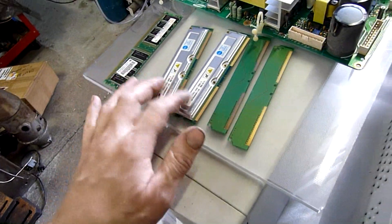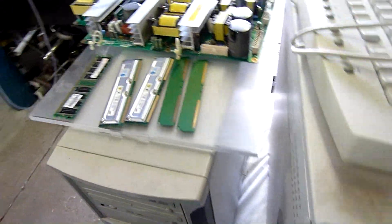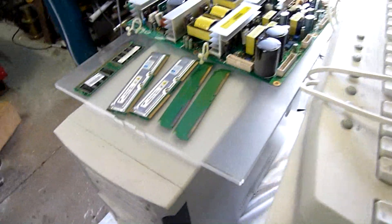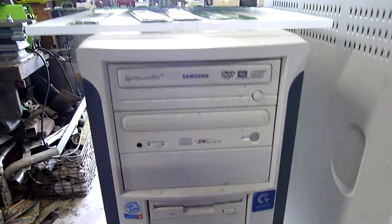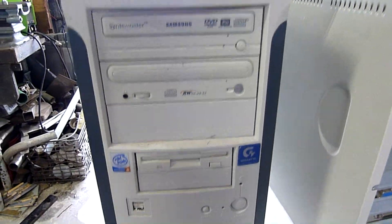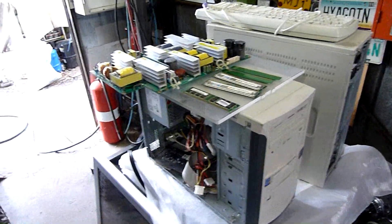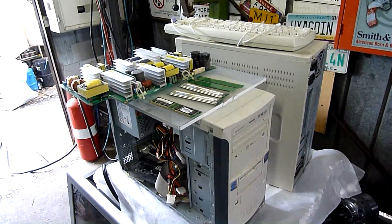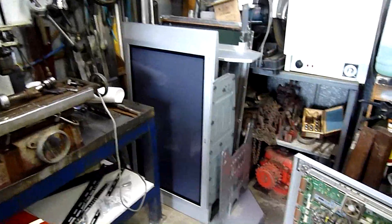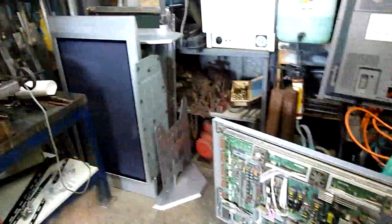The only thing is it runs RAMbus by the looks of it, so the chances of finding any big RAMbus sticks are pretty limited — they're only 128MB, and then you've got the blanking sticks that go in the opposite slots that you don't use. These systems are more of a novelty collector's thing. Just clean them up, throw Windows 98 or 95 on it and throw it on eBay for a hundred bucks and people buy them. It's got a Samsung Write Master in it too. Someone's taken the hard drives out, so I'll need to sort that. Most of these will be out of here soon anyway — I'm going to try and fix some of them, which has been successful so far.